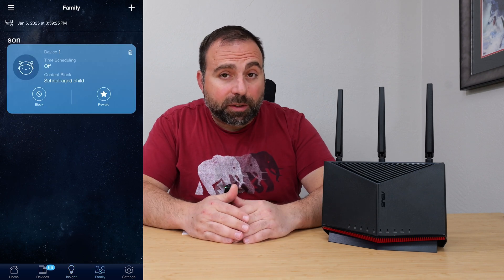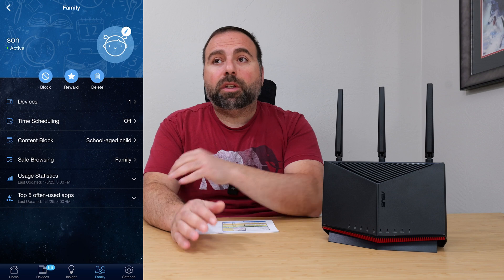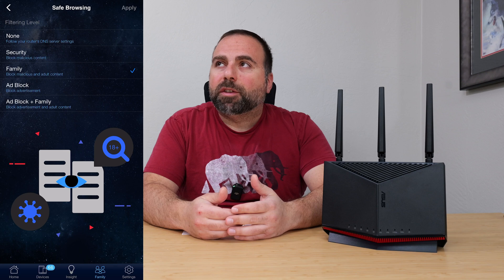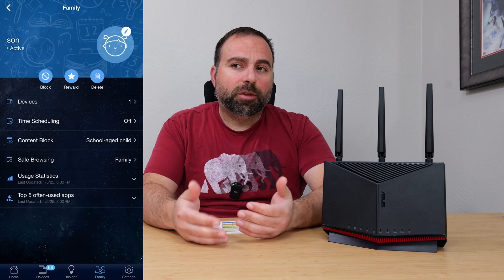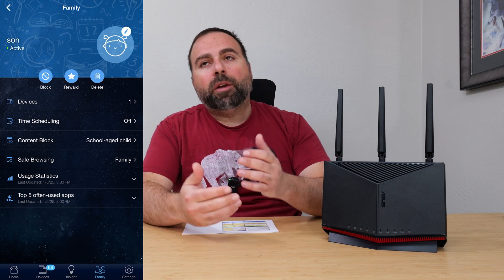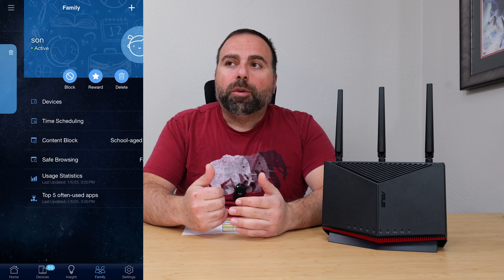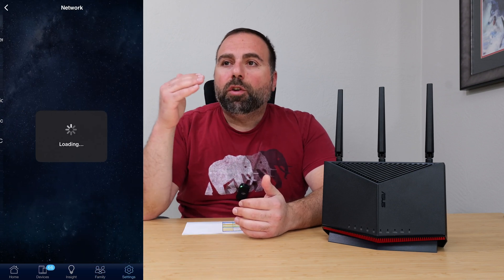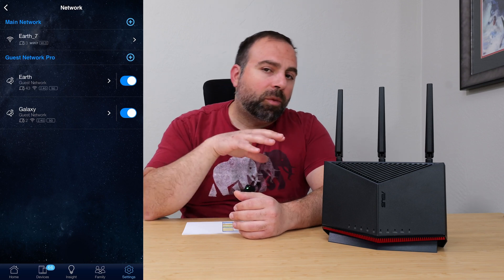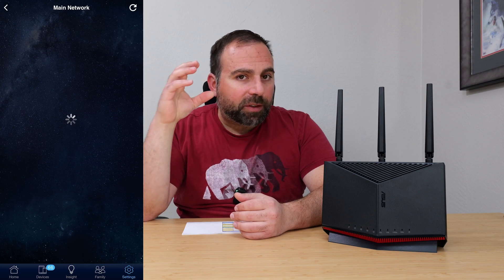You can also make different SSIDs, and that's something ASUS has been doing for about six months to a year now. Basically, with this router and other ASUS routers I've seen, for the SSIDs — which are the Wi-Fi names — you can pick several different ones. The Wi-Fi 7 setup creates a main network as your Wi-Fi 7 network, so Wi-Fi 7 devices connect to that one.